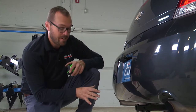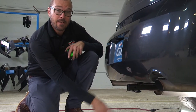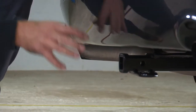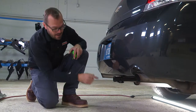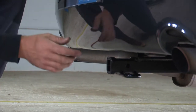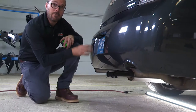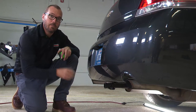Thanks for watching. A couple of key measurements to know about your new hitch on your Chevy Impala: the top of the receiver tube to the ground is twelve and a quarter inches — that's going to help you determine the right ball mount, whether it's a rise or a drop, to get the trailer coupler where you want it to be. The hitch pin hole to the rear fascia on this vehicle is six and a half inches, which is going to help you when selecting a bike rack, cargo carrier, or any kind of hitch accessory that has a vertical component to it.